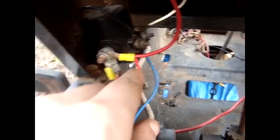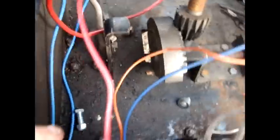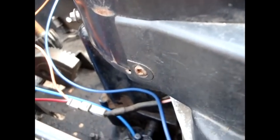This wire goes up to the push-button switch, as I already said. This little red wire that I have attached with it goes down and into this switch right here. Now, this is the charging switch. This goes up under the flywheel, and these wires go to a little thing that's on the inside of the flywheel, which charges your battery so it doesn't die.